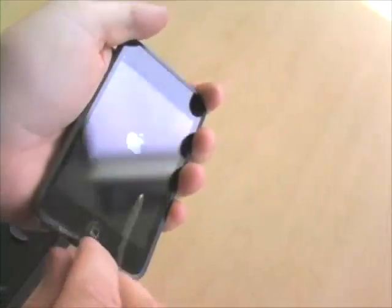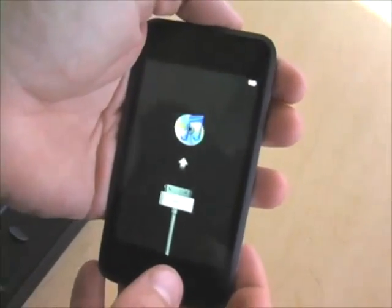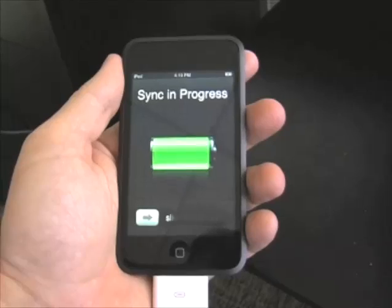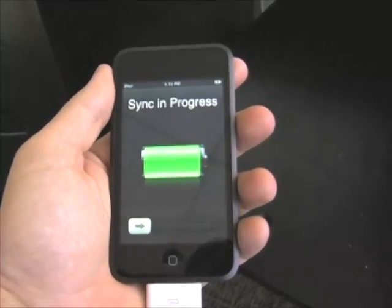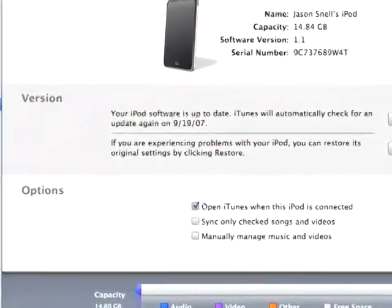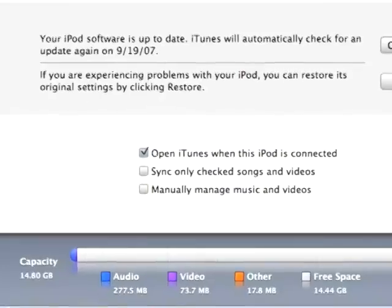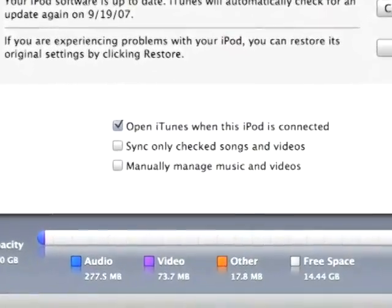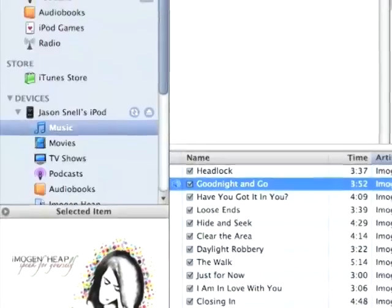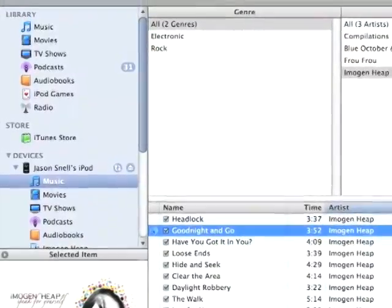See if we can get this thing woken up. The first thing it's telling us is to attach to iTunes, so let's do that. This looks very much like a sync screen for an iPhone, and that's true both on the iPod Touch itself and in iTunes. You've got tabs and you can set your syncing. One big difference from the iPhone is the 'manually manage music and videos' option — something you can do on other iPods but not on the iPhone. With that option checked, you can drag files onto your iPod from within iTunes without a syncing system, and you can even select music on your iPod, double-click a track, and it'll play back while it's attached to your Mac. Much more flexible.